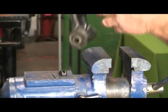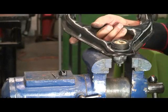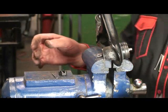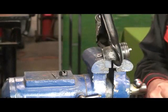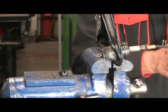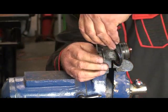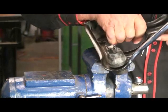There's a zerk fitting in the ball joint, so we're going to put the zerk fitting in and add some grease to it. The ball joint comes pre-greased, but we're going to give it about five strokes. So we don't lose the nut, we'll put the nut on and a cotter pin in it. There we go — we've got it set. Another job well done.